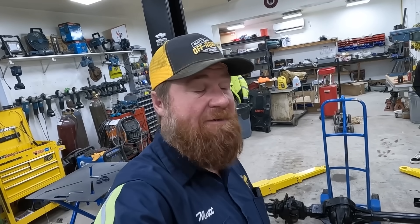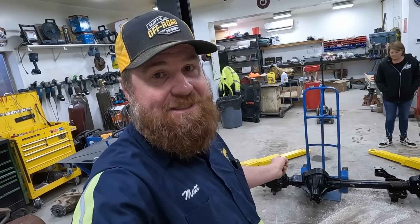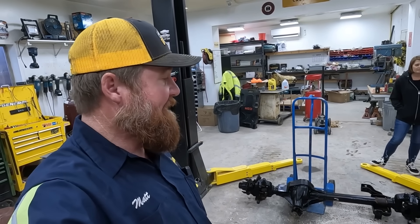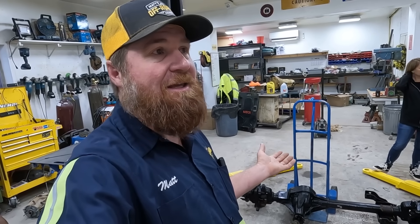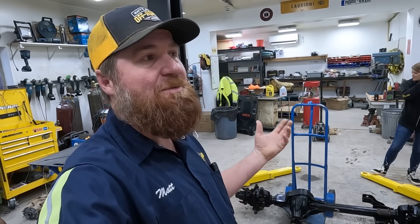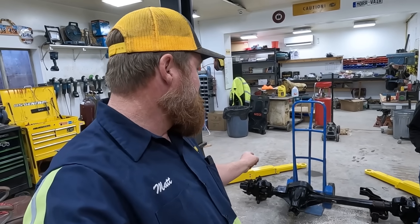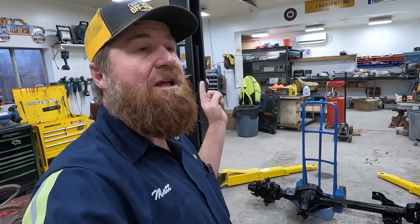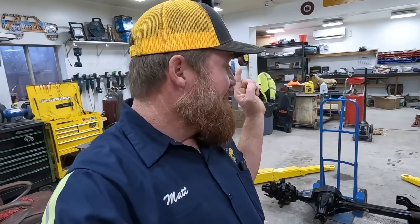What we have here is a 1999 Super Duty front axle. It's a Dana 60, it's a high pinion. It's way beefier than the Dana 44 that we have in the Banana, and we keep breaking it. Now we broke the ring and pinion. This will be a solution to that. The problem is it's too wide, so we're going to be narrowing it. The knuckles on these are hard to weld to, and there's not a lot of aftermarket support for them.